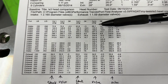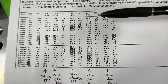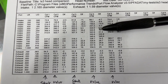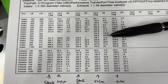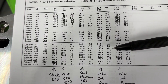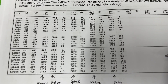Cylinder four is the modified version - valve job and blending on the small bore head. It's still down 6 CFM compared to a stock 823 at 400 valve lift. But at 600 valve lift, we're up 31 CFM and it now flows 344 at 600 - that's pretty good. It peaks at 351 at 625 lift. The exhaust really picked up from the valve job: before it was only doing 245, now it's doing 257-258. It's only below a stock LS3 head at 0.1 and 0.2 lift - the rest of the time it's up considerably. 41 CFM is a lot.